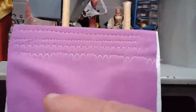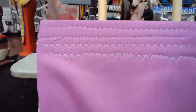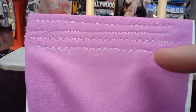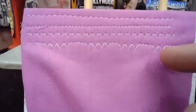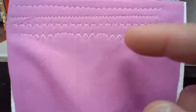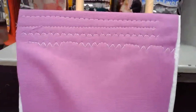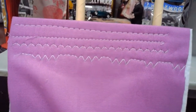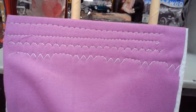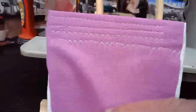and lock stitch. And you can kind of see what I was talking about. We got just a little bit of puckering on the back of here, and that's a product of presser foot pressure. Also, I can see more definition on the lock stitch as well, which is telling me when we're executing a stitch with needle swing, especially when I'm swinging the needle using that lever, we might want to back off that upper tension just slightly and give a little bit of this definition to that top stitch. And I'll leave the rest of this piece of material here for Pennie to goof around with and have a little bit of fun. So let me throw that to the back.